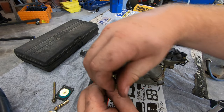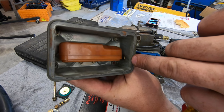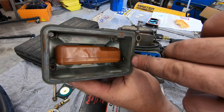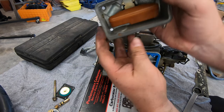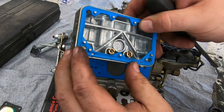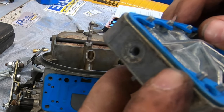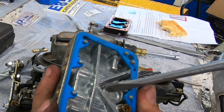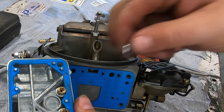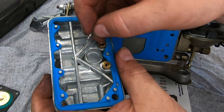It's mostly the same story with this side with a few differences. What we should have done on the other side is take note of where the float bowl level is before you take it apart — then you'll get it a lot closer whenever it's in the car. The old aftermarket Holley metering block is already blanked off for us. Wait — it was a piece of casting left over from manufacturing. That's kind of neat; I guess I didn't do a very good job of cleaning this up.